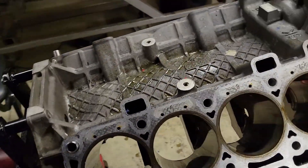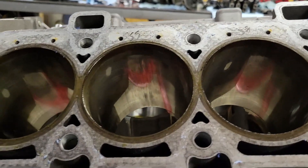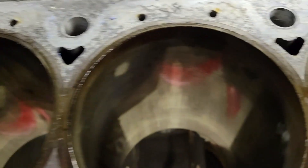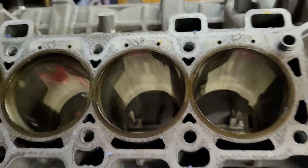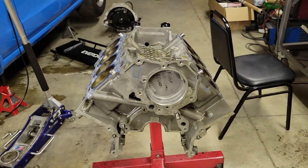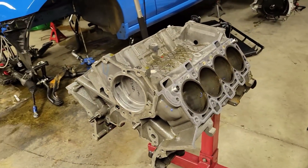I'm wondering if the overly smooth cylinder wall finish is part of the reason those couple of cylinders got hurt. You can see where that piston started to take itself out — those cylinders are still pretty smooth and shiny. They need a deeper crosshatch to carry more oil and help ring seal, which will help our blow-by situation. Anyway, I'm going to put the main caps on, get it back to the shop, get a hone on it, and get some pistons ordered.